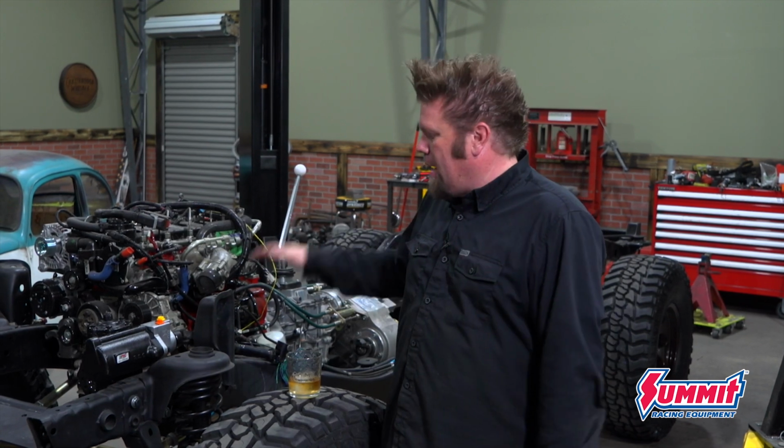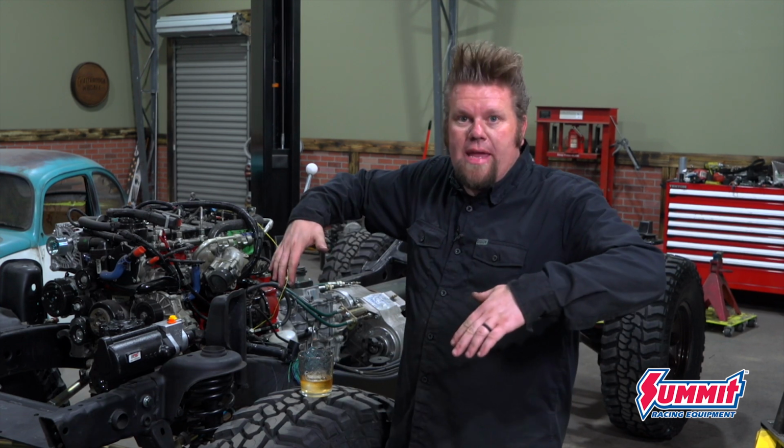You probably noticed that I didn't tighten any of the bolts, and I don't do that until the entire weight of the body is back on the frame. That way the joints won't be in a bind. If I tightened them when the suspension was hanging, when the suspension went to compress, it would actually bind the joint. So it's best to wait to do that.